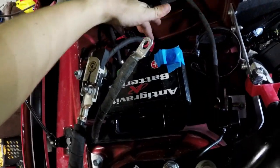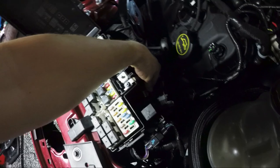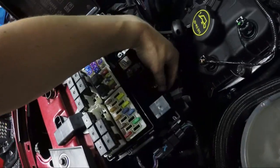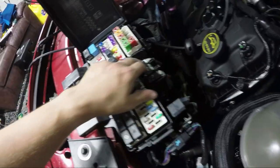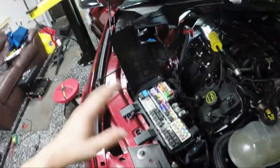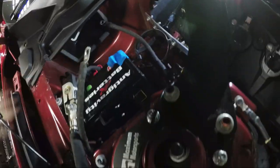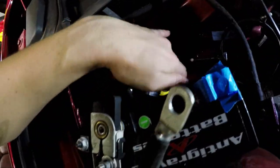Then we come off the solenoid and go into this cable, which I've routed along here where the negative wire is, and it comes into the far left terminal on the distribution box. The two cables that were originally there are now fused together with a 300-amp fuse — I just took two bolts off the terminal, went into the fuse, bolted them down, then put heat shrink over it, same on the other side. That completes that circuit and provides power to the box, which then provides power to everything else. We're ready except for a couple of terminal boots and that post.